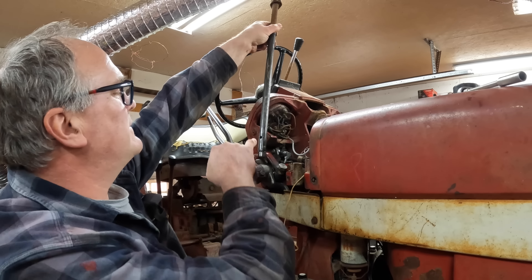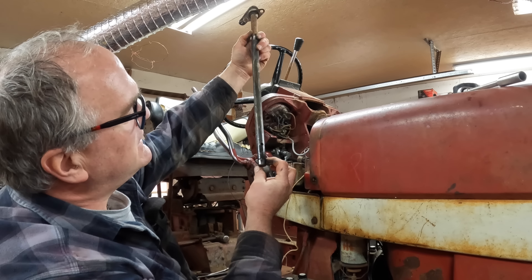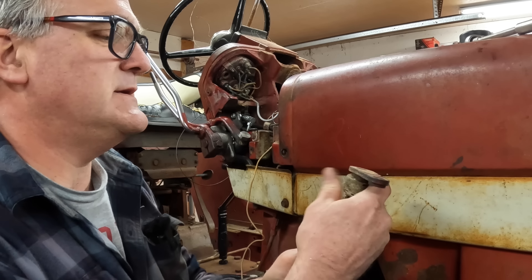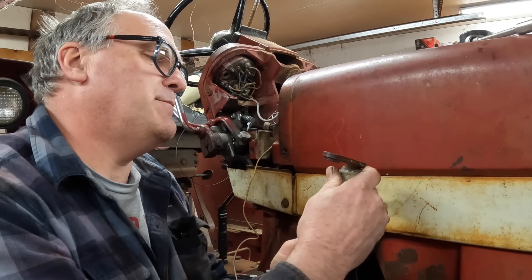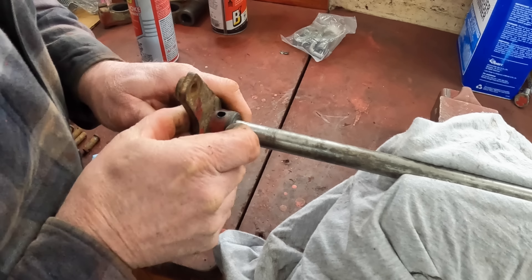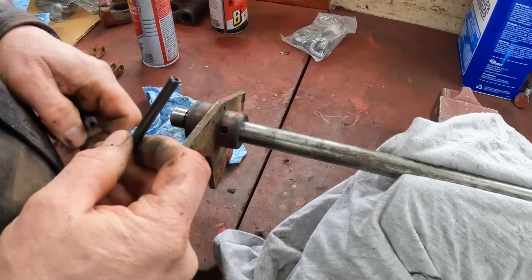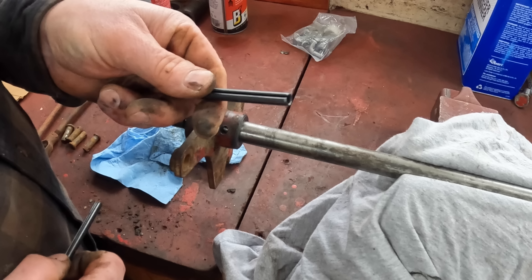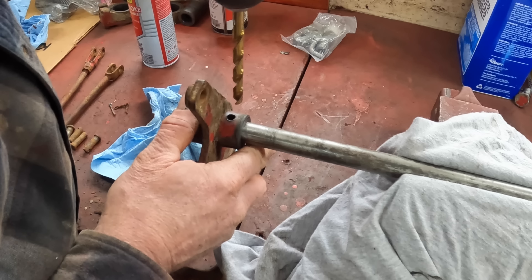Not something I planned on doing, but so be it. There's where it seats — oh, there's an O-ring in the bottom; it must go into the transmission case. This bracket with a little kind of ball joint on the top is also a wear item, and you can get replacements from the same spots you get the shift kit. But this one's in fine shape. Everything's egged out — this hole's egged out, the bracket's egged out. It's all eggy. And that is why I not only got a quarter-inch spring pin, but I also got a 5/16-inch spring pin.